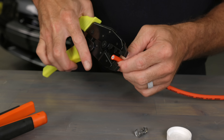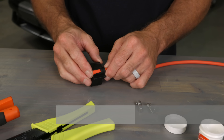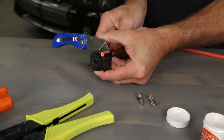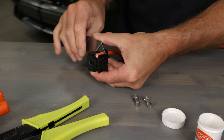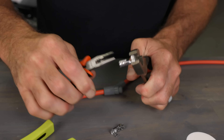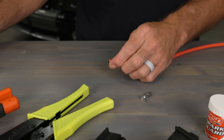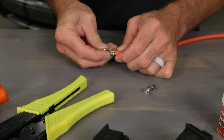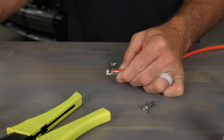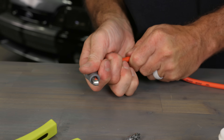Next you'll need to remove about three quarters of an inch of the insulation from the wire. You can do this using one of our handy plug wire crimping tools, or if you're using a vice style crimping tool, slide the wire through the hole until it's flush with the end of the tool. Now use a razor blade and place it against the stripping guide and rotate the wire 360 degrees, then pull the wire to remove the insulation and expose the conductor wire. For the best crimping results, bend both ends of the crimping tabs found on the terminal inward at about a 90 degree angle. Now fold the conductor wire back 180 degrees and lay it against the insulation. Slide the terminal over the wire, making sure that the conductor wire remains folded back and that the insulation protrudes past the crimping tabs about an eighth of an inch. Now using your plug wire tool, crimp the tabs onto the insulation and pull the plug boot into position.